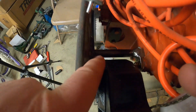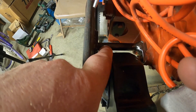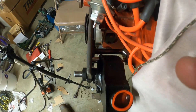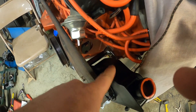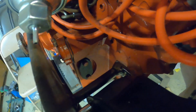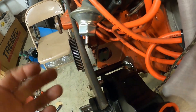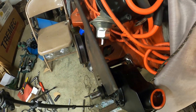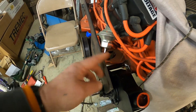I have this back bar in here — I had it close and then just welded that on. On this side I kicked it that way because I knew I was putting a power steering pump here. There's another bolt right there off the main block — you could flip that around and use that one. So I realistically have two 7/16-inch bolts over here and one 3/8-inch bolt holding this to the front of the block.